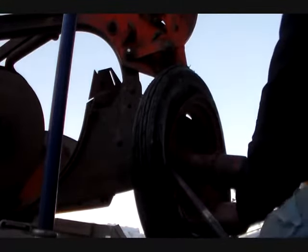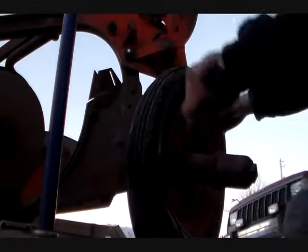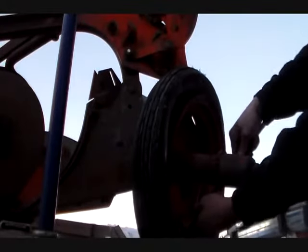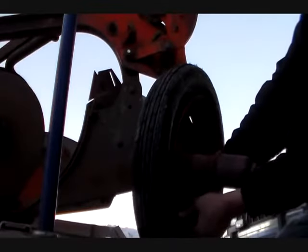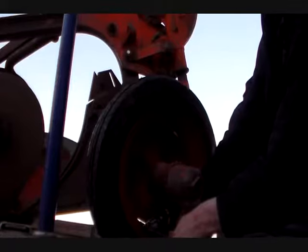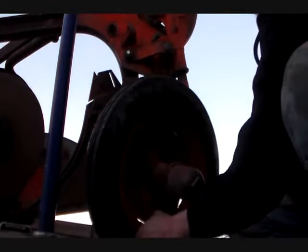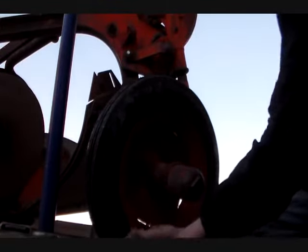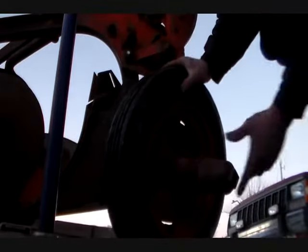Just like before, you don't stretch the tire — you've got to get this side down in the dip in order to get the other side over the lip. Now we've got just one section left right at the valve stem. Pull the stem out, hold it with your needle nose, unscrew the cap, take the washer off, and then air it up. A little air comes out around the valve stem at first — you don't have to worry about it; it might just be air between the tube and the tire. If it keeps coming out, maybe you poked a hole in the tube and you've got to take it back apart. But I think we're sitting pretty good. There we go — looks mint, better than it was. Good enough for what it is.